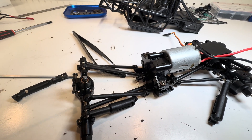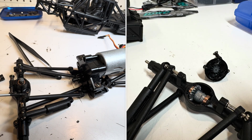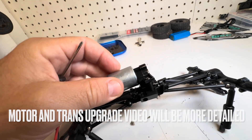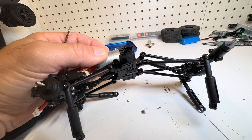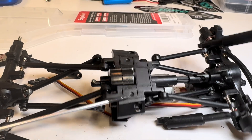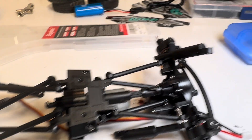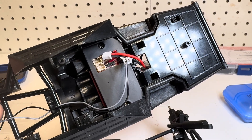Off-screen I took the screws out and pulled the cap off and confirmed that the gears inside the differential are also metal. Two screws would allow this motor and transmission assembly to come apart from the motor mount or skid plate — it's kind of a dual-purpose item. I think we've seen enough to know how easy or not-so-easy it would be to repair or upgrade. To wrap up the video we're going to drop the electronics out and review those.